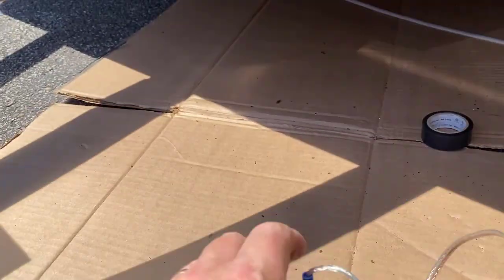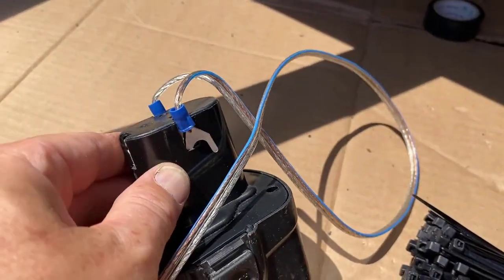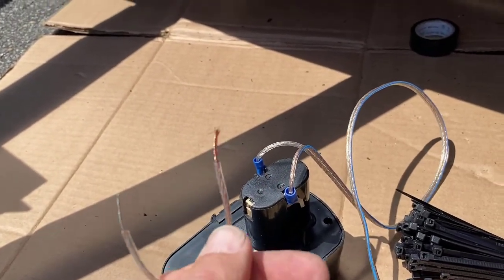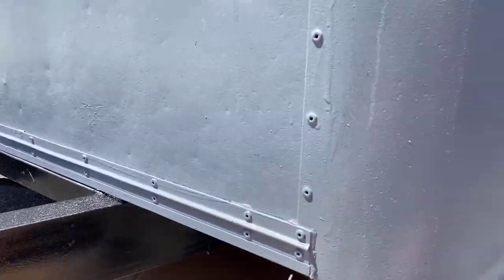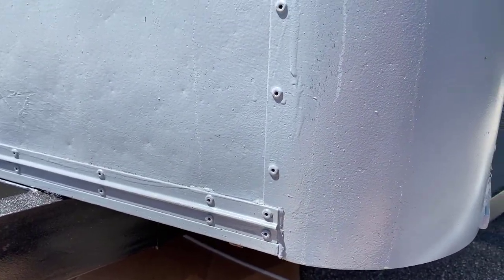When you're testing your lights out, you can just take your extra drill battery. I use a couple of fork terminals and a piece of speaker wire with varying lengths so that way they can't touch each other. Put one against the frame because you've got the ground up there at the white, then take the copper to your light bulb, and you can verify if it's actually working before you button it up.